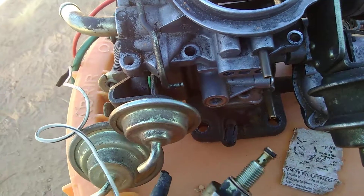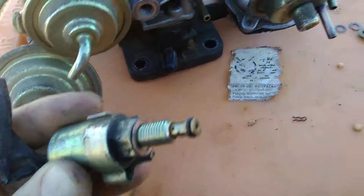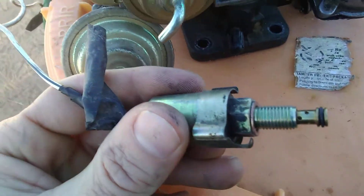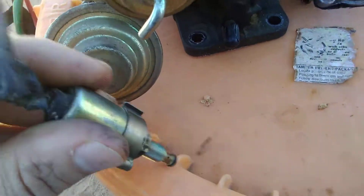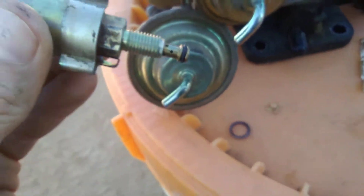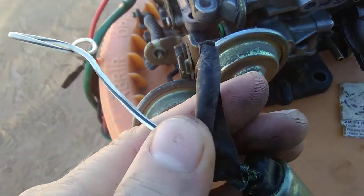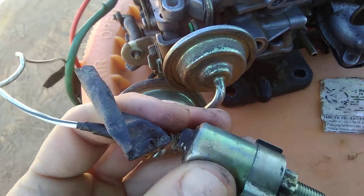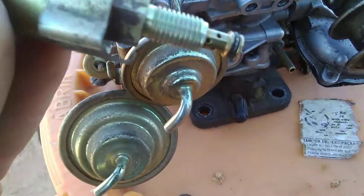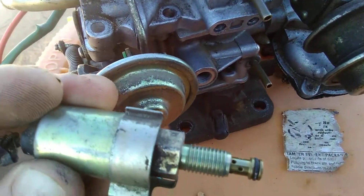To check the secondary solenoid, take it out. This is where I didn't find any ideas on YouTube, so I'm showing you now. These things get stuck, usually because they've been sitting a long time and the gas turns to varnish. To fix that, tap it down on something metal and you can hear it jiggle — that means it's probably a good one. Run its wire to a power wire; since it has one wire, run that to power and touch the body to metal for a ground. If it clicks, it's working great.